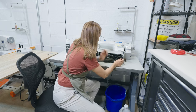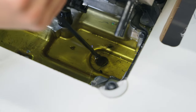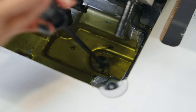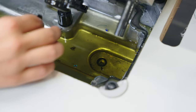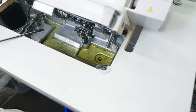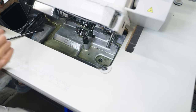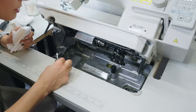I've broken out my big screwdriver, which is going to give me a little more leverage because this is a pretty tight screw. Diving right in — you are going to get a little oily here. I can already hear it going. I don't do this very frequently; honestly I probably haven't drained the oil and refilled with clean in two years. As you can see from the color, I've probably waited too long. I'm also hoping that some of this grime, threads, and sequins will find their way down into that bucket — and they are. We've got most of our oil drained out.